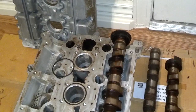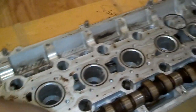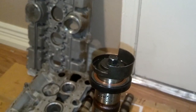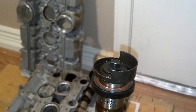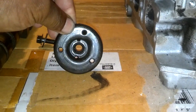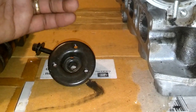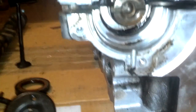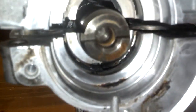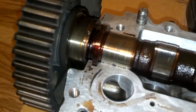Be careful with your journals when you set those in there and pull them out. The one with this disc on the back of it is the exhaust cam, because that goes through your cam sensor. When that rotor cap came off, it also pulled the cam seal with it — full of sludge. The hole there is not clogged up.